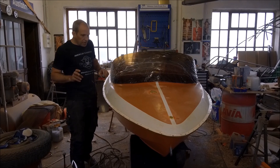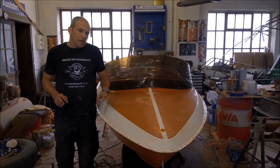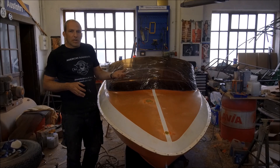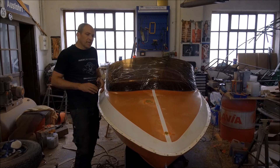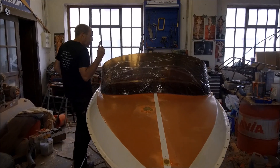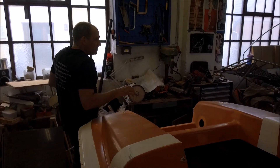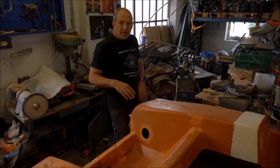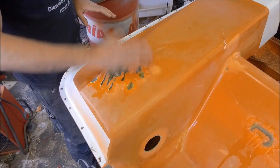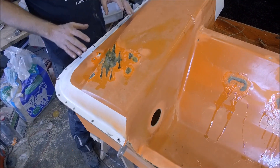Not too much going on — we actually just started. It's a little tacky, so we just started filling the holes with fiberglass. Obviously not just putting putty on it, but you remember we patched up this fiberglass from underneath and now we had a good surface to start with. So that's all reinforced and closed. If you follow me to the backside, you will actually see that those bad ones — you saw me grinding it down before — are all covered up now. And obviously that gets ground down so it's all flush. Then the minor things are done with putty.